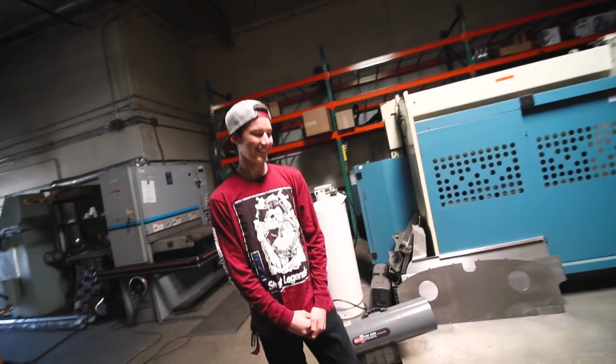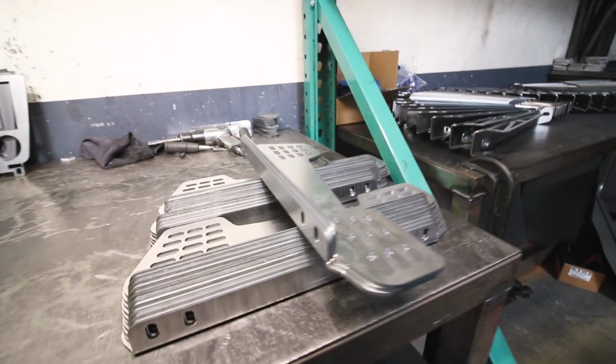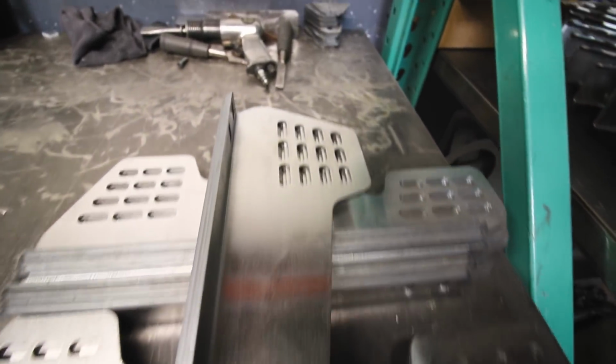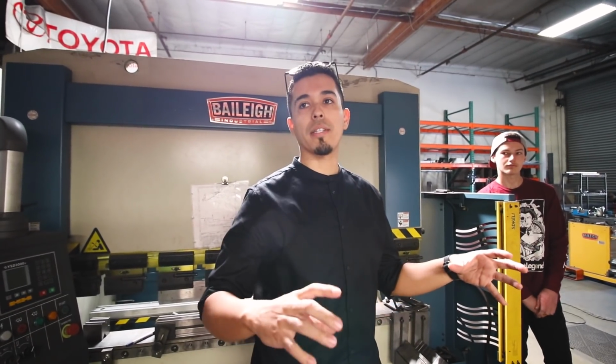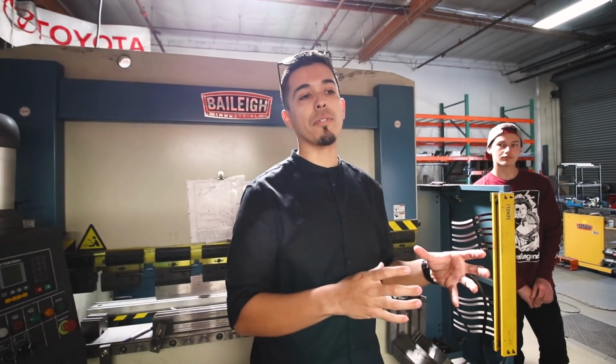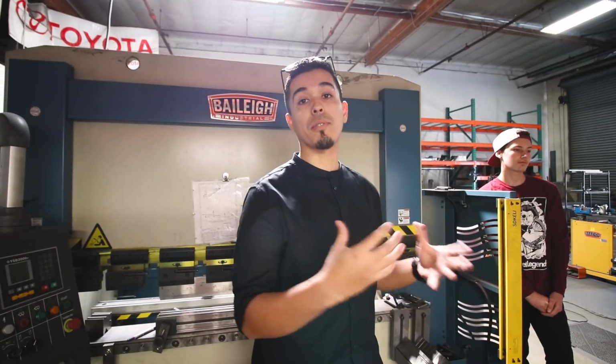That's really good. So I first heard about you guys because of your seat brackets. They were like the first seat bracket that actually fit a car where you didn't have to sit on the seat, jiggle it. Like, you guys actually engineered them extremely well. Yeah, I mean, we go through a 3D scan process, so we scan the floor, and then we take that and CAD model the design, and we can contour to every little divot and pocket that the OEM floor has, so they fit every single time. So each of our seat bracket applications are specific to that car.